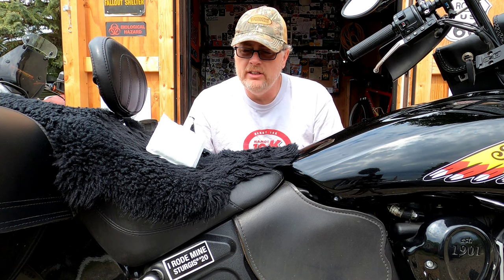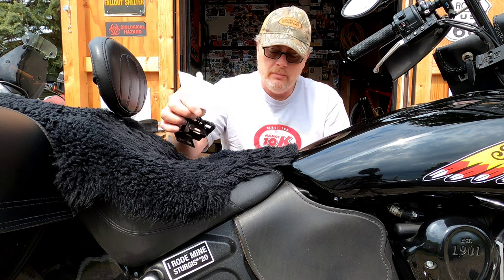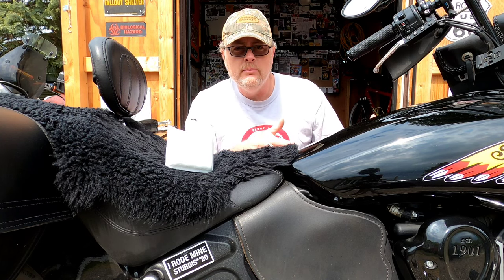All right, today folks, we're going to be doing a little maintenance on the Indian Scout 60 here. Mine's a 2018, like I said. I've got about 44,000 miles on it. We're going to be changing out the fuel pump screen, which should be done around 25,000 miles. Indian recommends that. I haven't had the time to do it until today, so we're going to be changing that out, which means removing the tank.